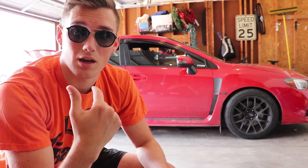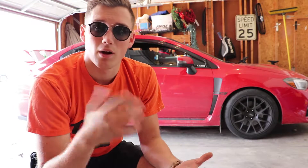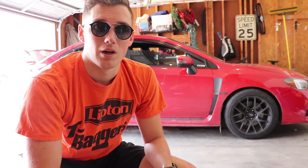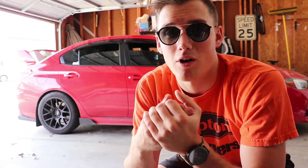I've got Cars and Coffee coming up, so we're going to put the stock pads back on after we take the Carbotech off. They might only have a little bit of life left in them, so I'll probably be looking for a street pad soon. For the most part they held up — if you guys saw my last video of my track day, it took some getting used to but it was a great choice overall. We'll take you on a ride and explain the process of stripping the rotors using the track pads to get the rest of this transfer material off.